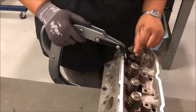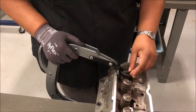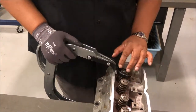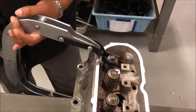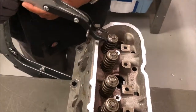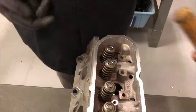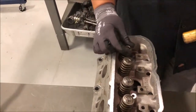All right, here we go again. Just going to drop it in there just a little bit so that you can get both of them in. Make sure you put in the right side — the narrow side goes in first. Then that goes in there like that. Now at this point we're going to release the compression off the spring. You see how that comes up and matches up and meets on one side. And that's how you remove and reinstall the spring on the valve, on the intake valve.